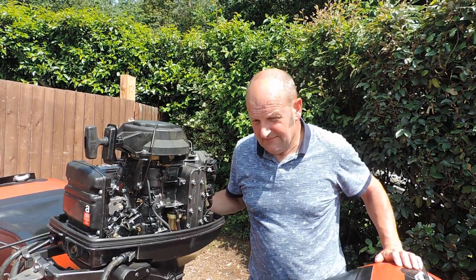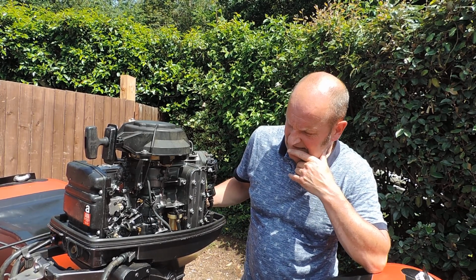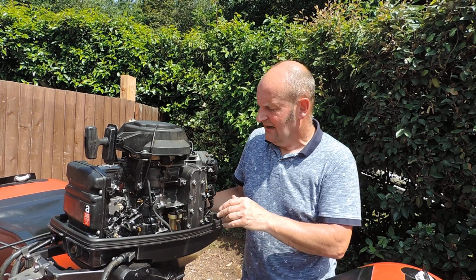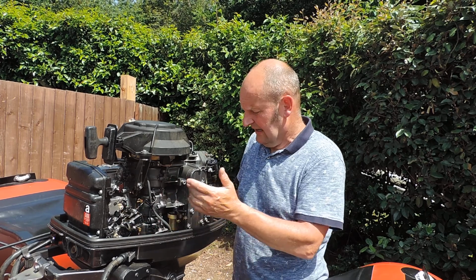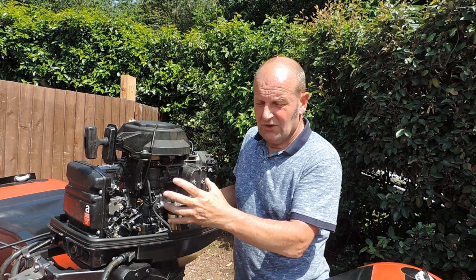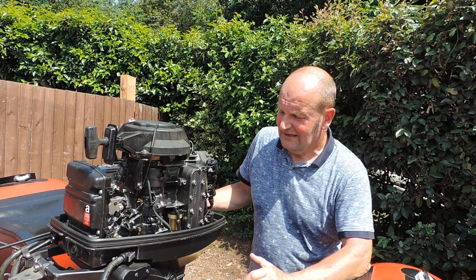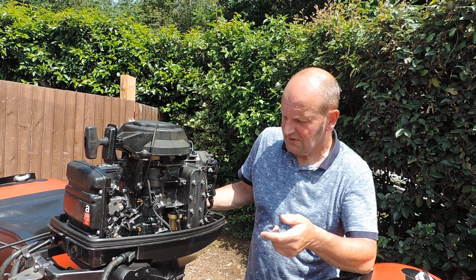So, as I say, if this video has helped anybody, great. But if you buy a second-hand engine, it's not just a Suzuki, it's basically any engine. When they're misfiring, it's nearly 9 times out of 10 either the carburettor, or you've got not a very good spark at one of the cylinders. But once you know you've done those 2 things, for the sake of £10, renew the fuel pump, because it could be that, especially if you've got a 2-cylinder, it's the bottom cylinder that's giving you the problems.